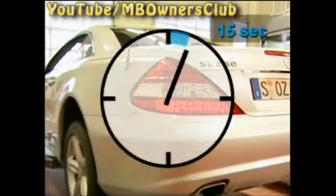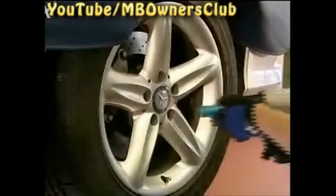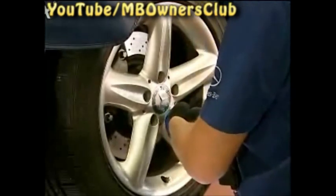Now unlock the vehicle for at least 15 seconds. Subsequently lock the vehicle again. The self-check is now deactivated. Be sure to keep the key in a safe place, because the vehicle may not be unlocked under any circumstances during the work on the brake assembly. Now because the self-check is deactivated, it's now safe to work on the brakes.